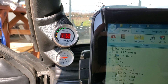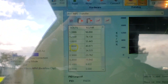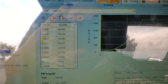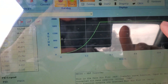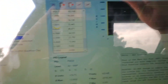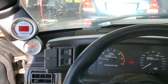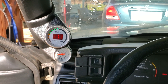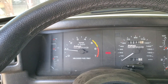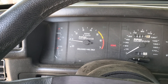It's a little on the rich side still. I took some fuel out but it still needs a little bit more. So what we're going to do is take a little bit of fuel out — probably take out of the whole entire curve. We'll take a little portion out to get that air fuel ratio closer to 14 to 15 to 1.